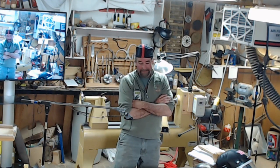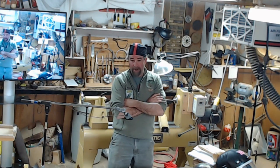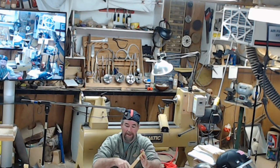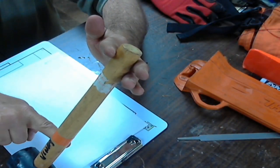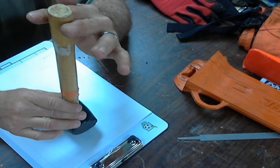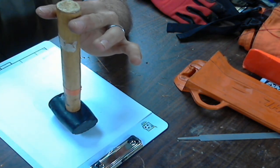It's where I try to put a rope in it, one way or another, so I can control its drop. But if not, say it tips over, it hangs up on something. So I make a backside notch, and then I start coming through here. And what it's going to do is keep falling into this spot to where it's going to stand up. It's nice to have a rope in a tree. Maybe you can pull it from there.